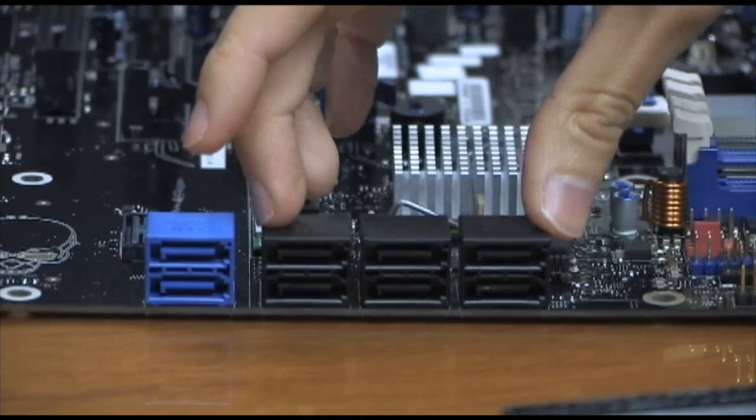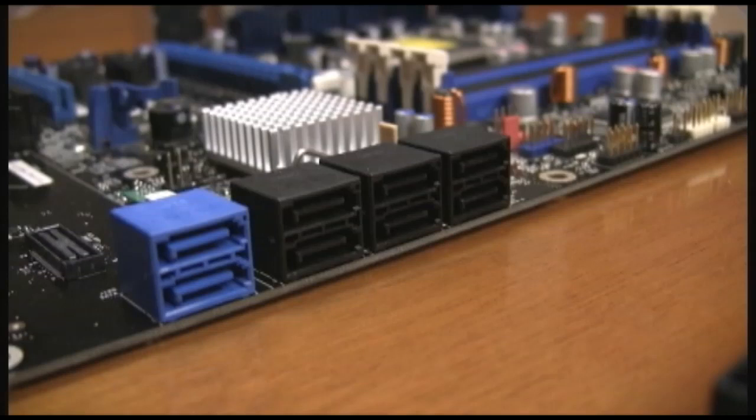Tell me about this — on the Smackover board you only had six SATAs, right? Yeah, for the SO we only had six. Now you have a different one, but that means you had to add another chip. Exactly — both the X58 and the P55 chipset only supported up to six SATA ports. So we've included another driver to support an additional two SATA ports on the KG board, as well as eSATA going out the back. We use a Marvell driver and chip.